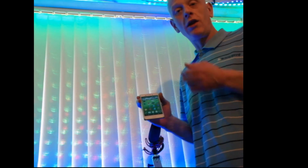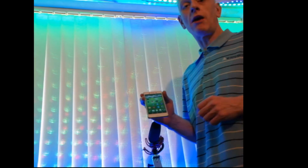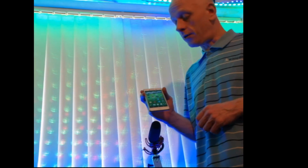But you know, if you're looking for a different app or whatever, just check that it does allow you to select an external microphone. So that's my guide on how to use an external microphone with awkward phones that seem to try and restrict everything you do. Obviously the other cable I use, the OMTP cable, the same method will work with that on phones that use that standard. So just check the manual of the phone and it will tell you which cable to use.